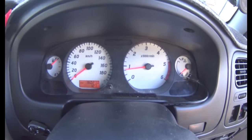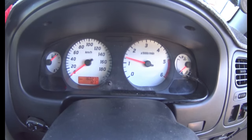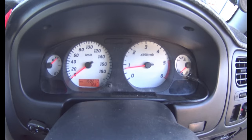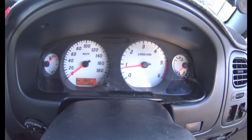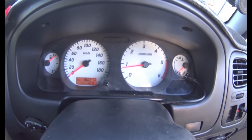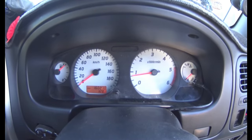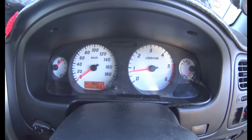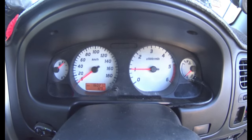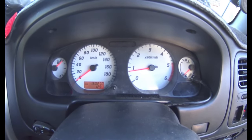She's idling - I wonder what our revs are like. Still getting a bit of black soot out the back - maybe it is the suction control valve, or it could just be running a little rough because of what happened. I'll let it idle for a tick and might try doing the ECU reset again because the check engine light didn't come on at any point, which it says it normally does. Actually it's revving properly now - maybe it just had a bit of crap in the tubes from all the over-fueling from the weekend.